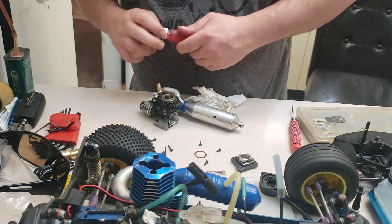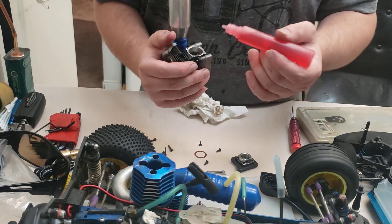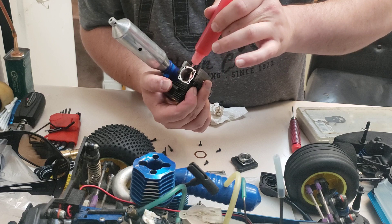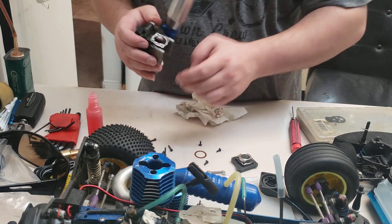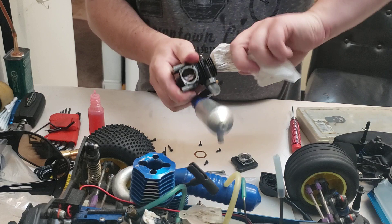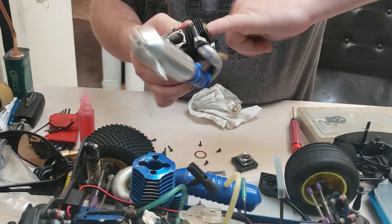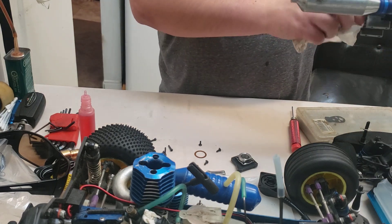What we are going to do is put a little bit of oil on - since we washed all the oil away, and this is why I don't like using WD-40, because it washes oil away. I'm going to put some oil on the crank pin, some down on the bearing, back there, a little bit up in the wrist pin area, a little bit on the sleeve. Just a little bit - you don't need to smother the damn thing. Let's wipe the inside of the cylinder here. Pretty nice in there. Just run your little finger around in there, because if you put too much oil it'll flood the thing and it won't start - but just so it has a little bit of a coating when it first fires up, that's pretty much all you're looking for.